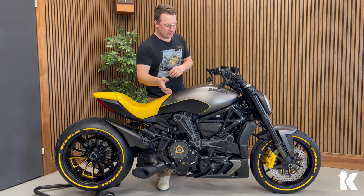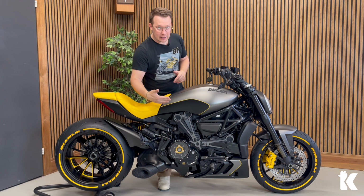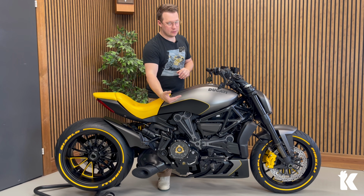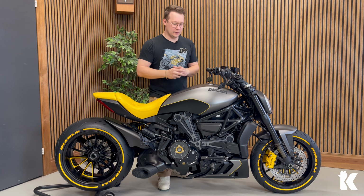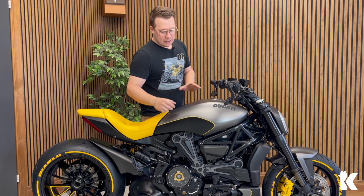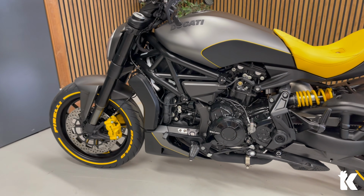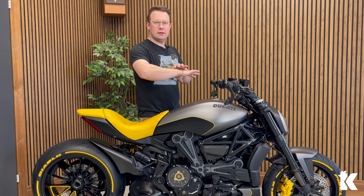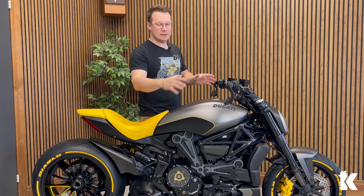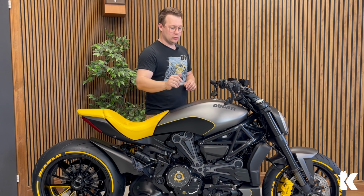Obviously the painting process again was a little bit complicated because this yellow line is quite hard to do. It's not a sticker again, like always. It is painted. So firstly everything was painted gray, then I did the yellow design, the yellow line and the black areas, then clear coated with the gloss, sanded everything, and then finally satin clear coated so that all the edges of the paints are smooth again.